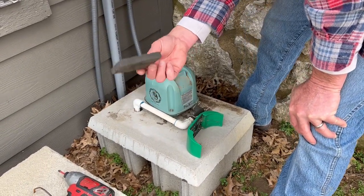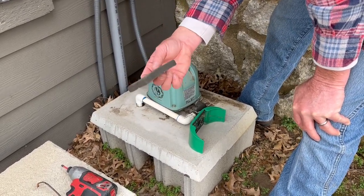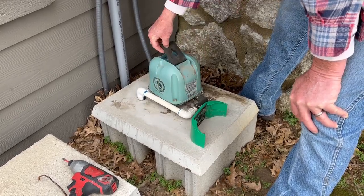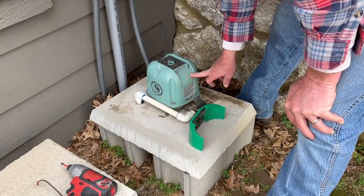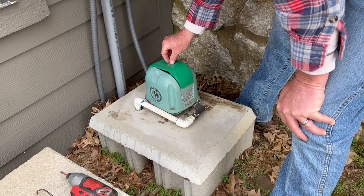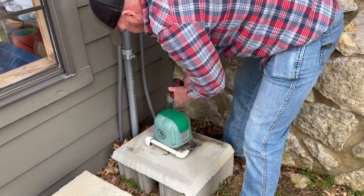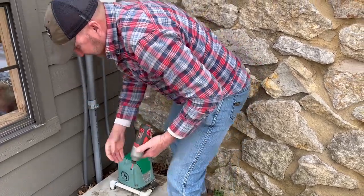Do not put this back in until it is completely dry — give it about 30 minutes. Once you get it completely wrung out, it's so thin that as long as you set it in a dry or sunny spot it's going to dry out really fast. Don't put it somewhere windy because it doesn't weigh anything and it'll blow away. Once it's completely dry, stick it back on top. You don't have to turn the unit off — it won't hurt it to sit for an hour without the filter, but I would highly suggest you don't run it without the filter for long because it'll burn it up faster. Then put your screw back in and tighten it up, and put your lid back on.